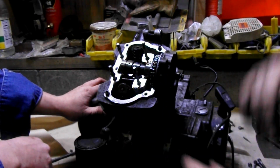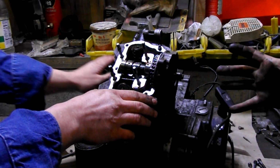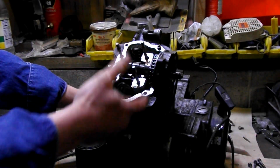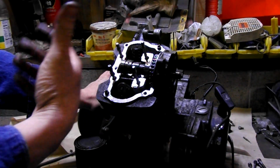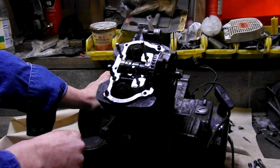We're going to have to get the whole thing off. I think that's how we did last time. Instead of screwing it up. But that's your timing chain still going to be attached to the crank as you pull it out, so you'll never get the cam to come out. I think we had to loosen it. If you loosen it, we can jump it off the teeth and go right down the cam. Exactly. I think that's how we did it.